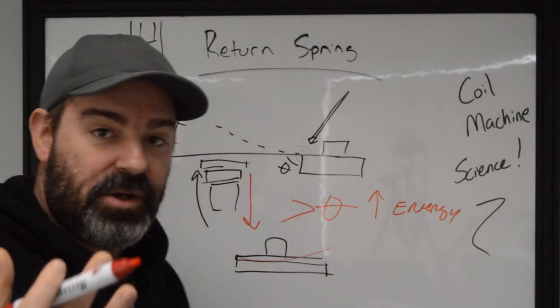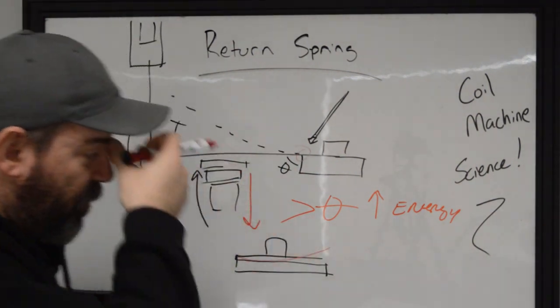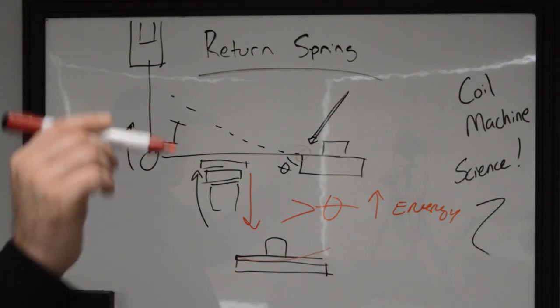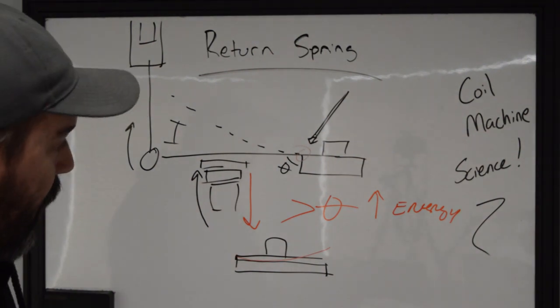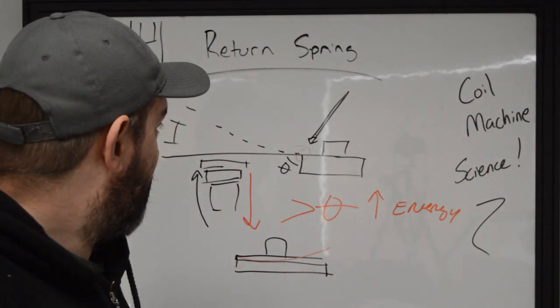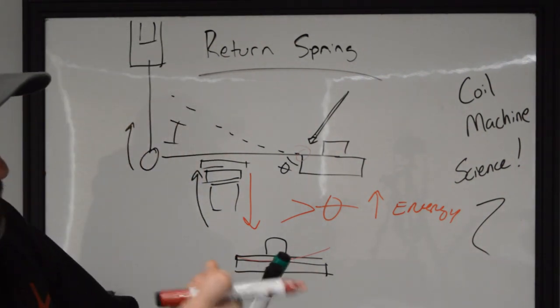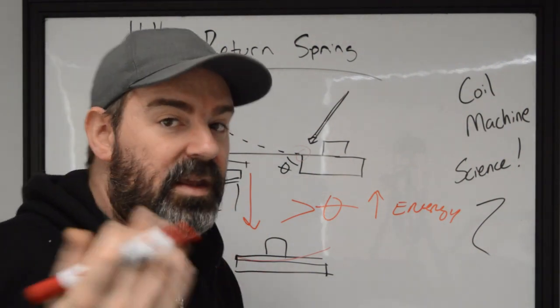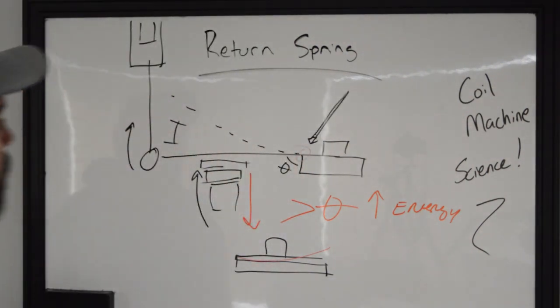And it'll cause fracturing to occur much quicker, which means that your springs will break more often. So if you see that your spring has a little bit of a wobble or a tilt to it, pull it back out, set it into a bench vise or something. Don't heat them up too much because you'll make them more brittle, but just set them in there, give them a squeeze, or even try with a pair of pliers to straighten them out. If you can't get it, get a new spring. It'll just help everything run better.